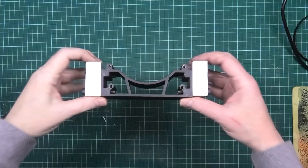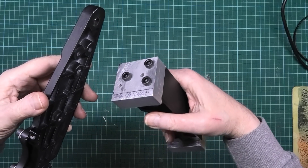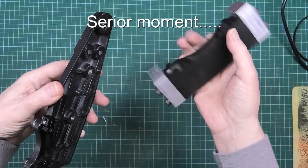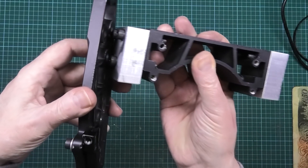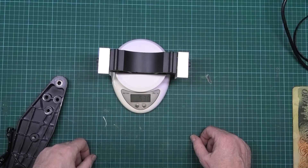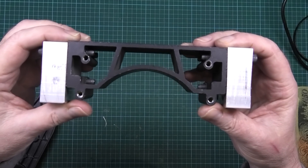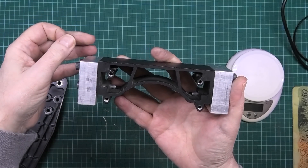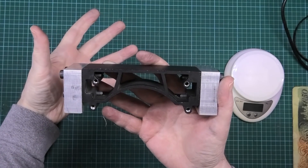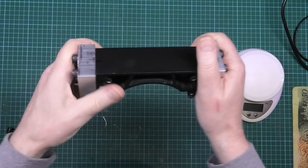This is the cross brace that goes between the two swinging arms - it bolts into those holes. I've been looking at ways to make this out of carbon fiber because it's heavy at 530 grams. I reckon I can make it at least less than half that weight. I'm going to make it out of a solid piece, forged, using a combination of forged material and woven fabric for the outside finish, but I also need the structural strength because it has to resist torsional forces.